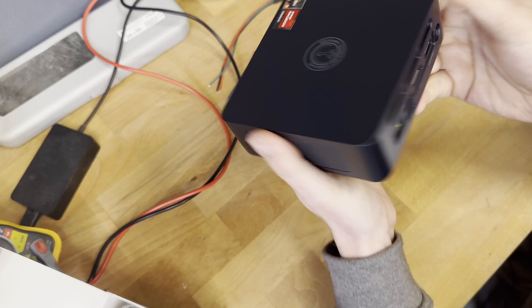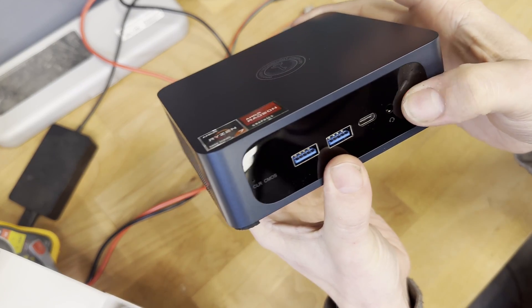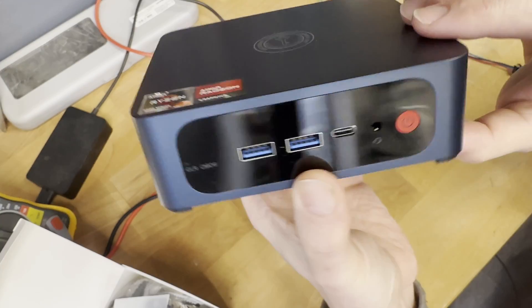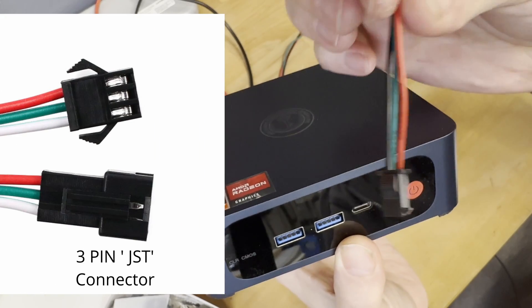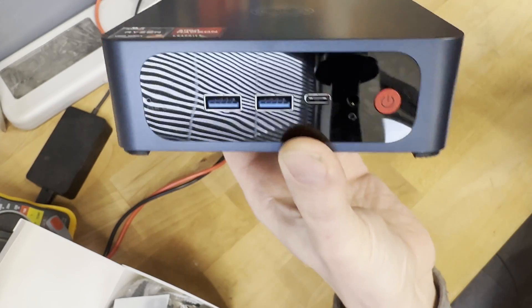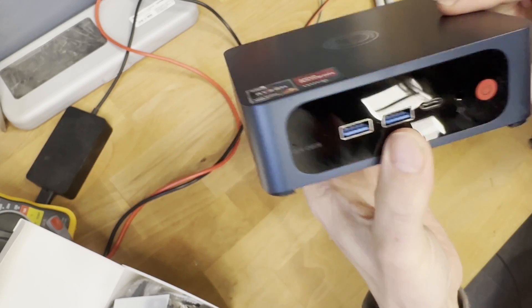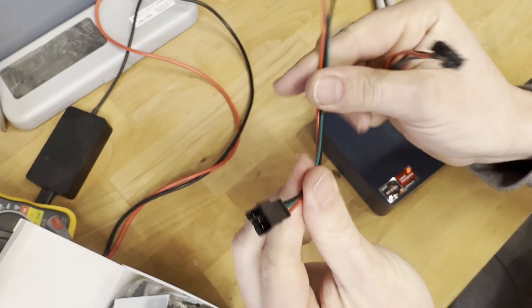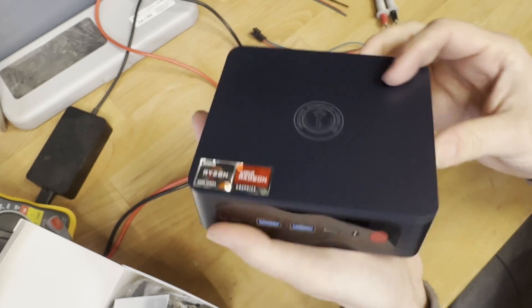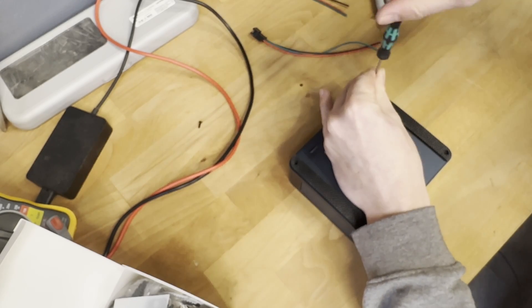So you can see the back of the PC and this is the front, and of course this is the on/off switch. We want this on/off switch to be at another location. We are going to add a small connector — this is a three-pin connector. We're going to drill a small hole in this case, insert it, and solder it to the main board. Then later in the arcade cabinet we can connect this to a cable and attach it to a switch so you can operate the PC from a distance.